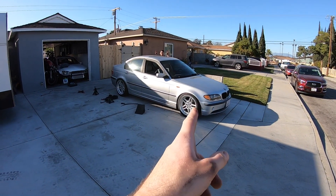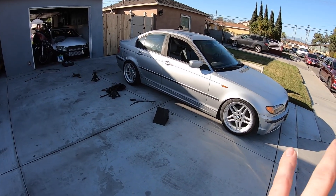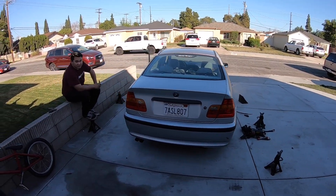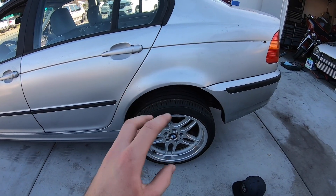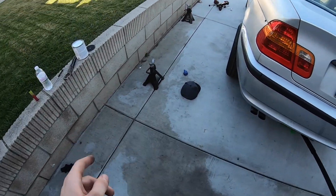If I could do this over again, I would do a 215/40/18 in the front on the 18x8s, and I would do a 225/40 on the 18x9.5s. That way you don't have to do all this crazy work and could probably get away with doing nothing. I went with a little bit fatter tires because this is a daily driven car and I wanted to be more comfortable - and occasionally when I steal this car from my girlfriend, I take it to the canyons. Now for the brushable seam sealer: you can get this stuff in a tub or in a tube with a caulking gun. You want it to protect from water, tire smoke, and debris - get the seam sealer right where the two pieces of metal separated. You should primer it before, but I did not. Thanks for watching this video on installing M Parallels and cutting our rear fenders and rolling our front fenders. If you guys want to see more on the E46, let me know - it's not mine, but I'll keep working on it if you guys like it. Thanks for watching. Peace out.